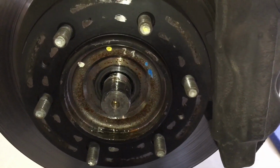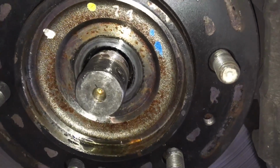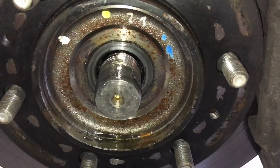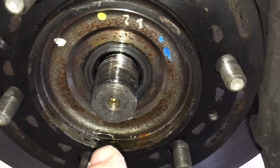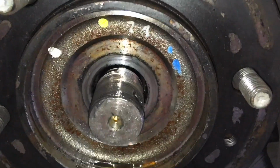And we're just really curious, when we give that a gentle tap, that should just crack free, but why have they bashed the hell out of it in the past? So we've got slight concerns, but we'll see. One other thing we sometimes do is we leave the nut on there. So rather than hitting the end of the shaft, look, there's a little indent in the middle where you can get the action happening in the middle there, so you don't have to burr the outsides of it.